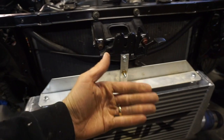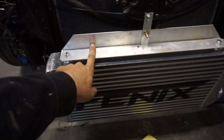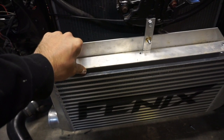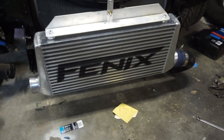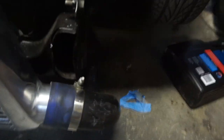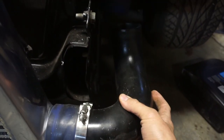I still need to check if I'm going to put the lights on and the guards and then test fit the front bumper to make sure we've got some clearance — might just have to notch it around here. I used some 50 by 50 aluminium, drilled the holes and cut some angles on it to make it look a bit better, and made up some little brackets underneath out of aluminium so it's pretty solid. Because my old front mount was bigger, I just need to get some 3-inch intercooler pipe to extend both sides a little bit.